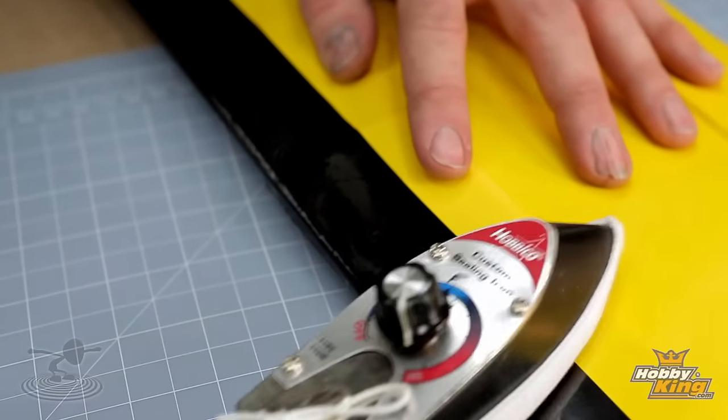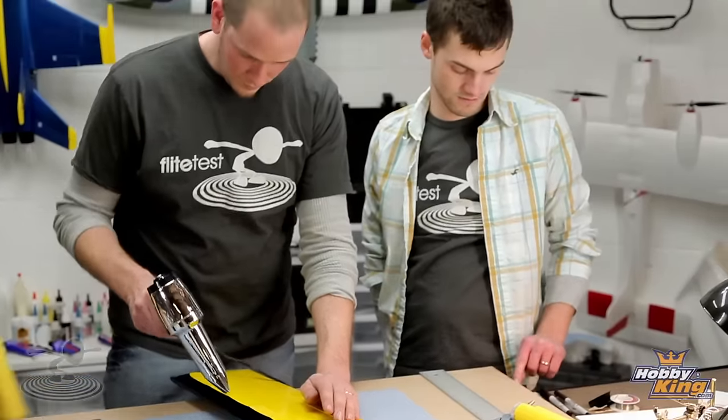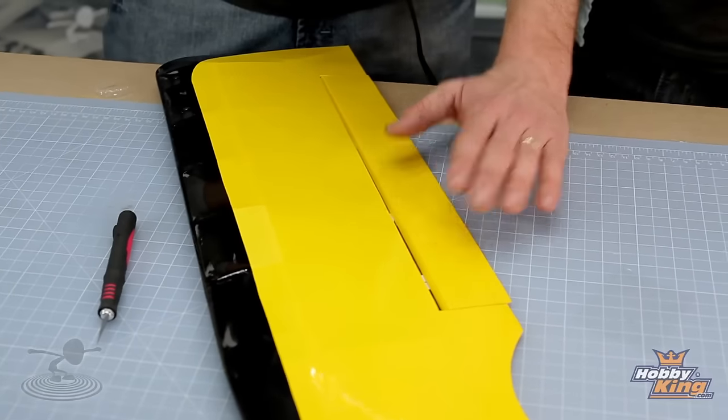You put little pin holes in there and then start working with a squeegee out — just work those bubbles out. Then after that, take your heat gun, get it nice and hot, and fan it over. One important thing: don't sit on the film until all the wrinkles are gone. Get on the film, work it from one end to the other, then take the heat off and let it continue to shrink. If you stay on the film too long, oftentimes it'll burn a hole through it and you don't want that — you'd be starting all over again. So basically, that's how you do two-tone. Start with the lighter color first, go with the darker color second — you won't have any issues. Always make sure you have a little bit of overlap. Every time you put another layer on, make sure it overlaps the other layer. Otherwise you'll have a raised edge, it won't look very good, and you won't have a very good seal.